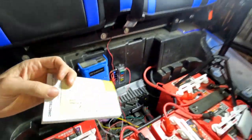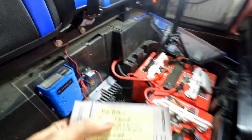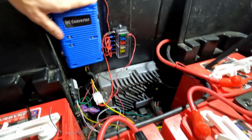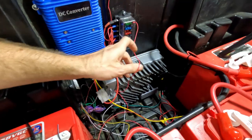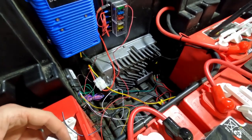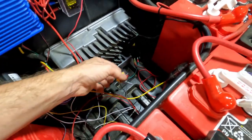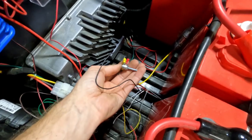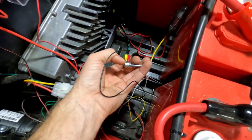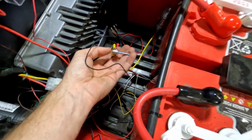So I've got some notes here. The red wire goes to the battery, or as your constant power — I've got a DC converter fused red wire that goes straight to the main box. The black ground wire: I have this fancy little machine screw right here, I separate it with washers, and every place I plug in I'll just add a washer in between them — that's how I'm grounding everything on the cart.